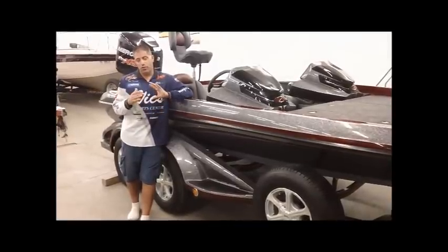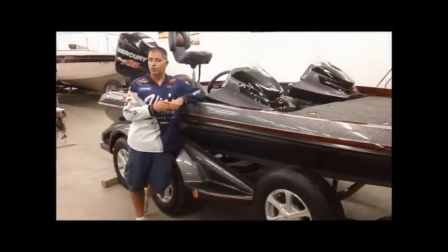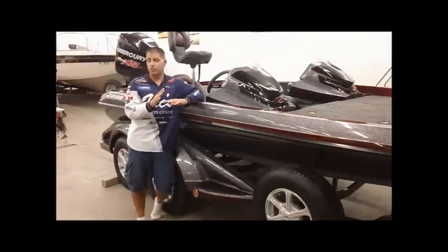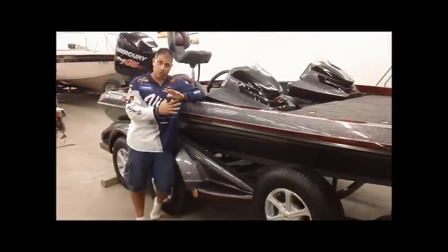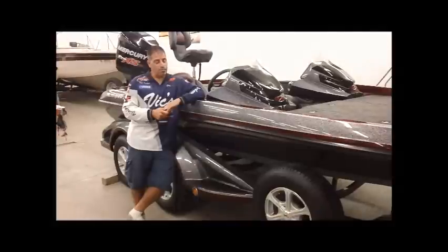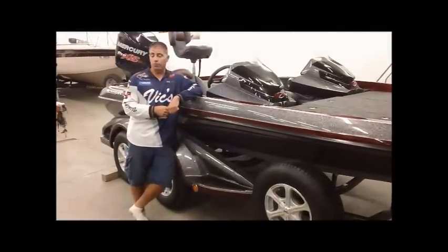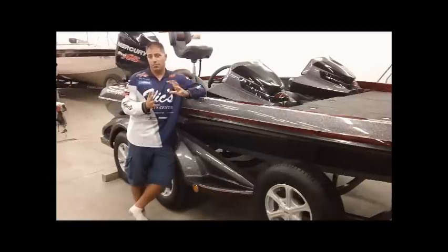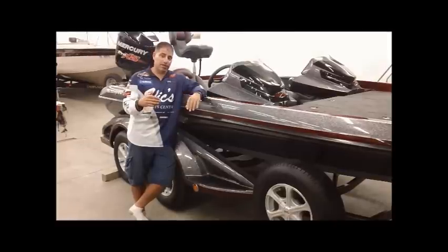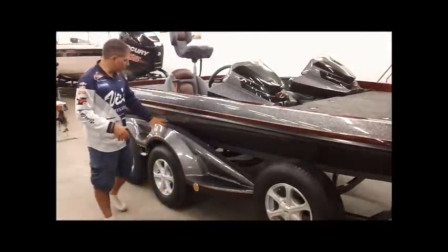And then also on painted trailers, the trailers that the customer orders in, like this particular trailer is a burgundy trailer, they actually spray paint on top of the road armor. You can see the surface isn't perfectly flat, but you have a complete road armor trailer with paint on top of it, which is a super feature for these boats, okay? Match that up with fiberglass fenders so you don't have any rusting on your fenders. Even if you went with high-end trailers in the older days that had stainless fenders, the step pads were still steel, and we always had rusted up step pads, especially if they put carpet on them, those would rust out extra quick. So it's very nice to have an all fiberglass fender.